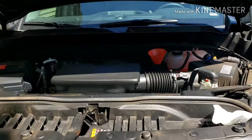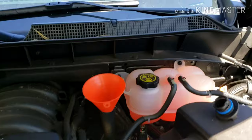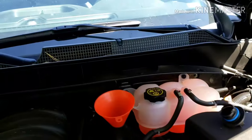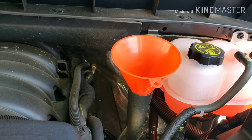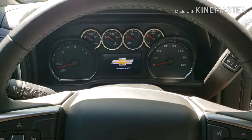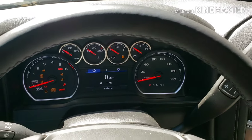Next is refilling the oil. If you haven't already, make sure your oil plug is tightened correctly and your oil filter is tightened. Here is where you're going to be putting the oil in, and this yellow bar is your oil dipstick. Since it's going to be eight quarts, I bought two five-quart jugs — I'll dump five quarts in, then measure out the next three as I pour.